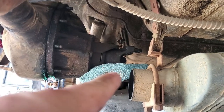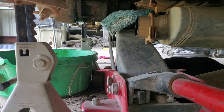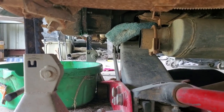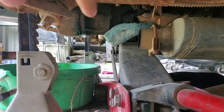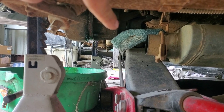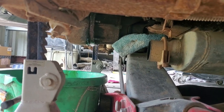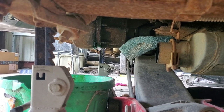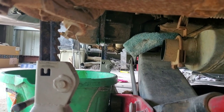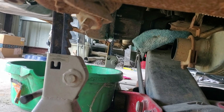I'm going to grab onto it from the front snout, right where it connects to the driveshaft — so you will have to remove your driveshaft for this. Then simply crank up on the jack. You're going to see the whole gear assembly being put under tension upward, and at the same time, pushing it upward is going to open up the gap at the back. The whole differential is going to want to tilt as I do that, and you'll see more fluid start to come out.